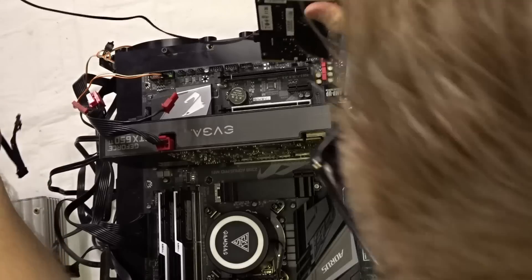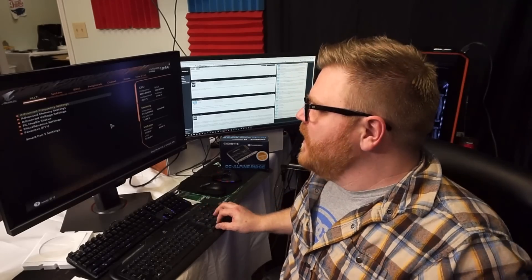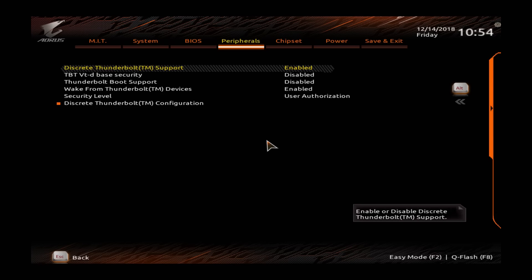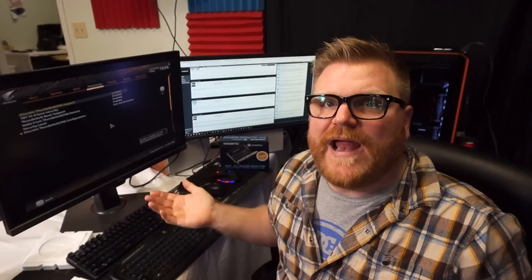I'm racking my brain and I know there's a BIOS option. The card has to be in the last slot, and you plug this little connector into the THB-C header on the motherboard. When I went into the BIOS I went to Peripherals and there's a Thunderbolt configuration option. Thunderbolt discrete support was enabled by default, so I thought it's already on - what am I doing wrong? I looked at some other videos. There was a guy with an Asus card whose BIOS had a bunch more options - you could actually pick which PCIe slot the card was in right in the BIOS, which would be interesting.